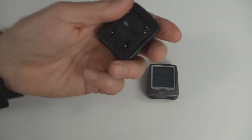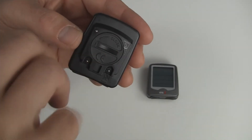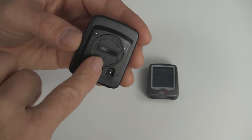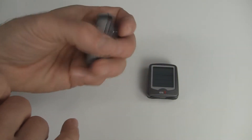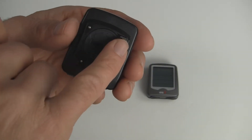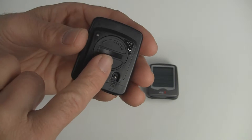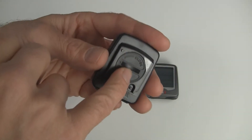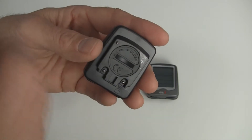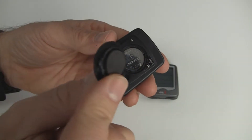To replace the battery, flip over the computer and you'll see a slot in the back. There's an indication arrow showing the close direction — turn it opposite to open. The battery type used in the DZ3 units is a CR2032, indicated on the back of new computers. For older versions, check the instructions or open the back. Use a large coin like a toonie — not a dime, as that could damage the slot. Turn it about a third of a turn counter-clockwise and the cap will pop out.